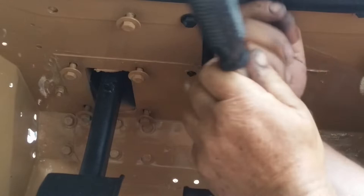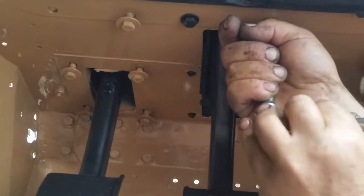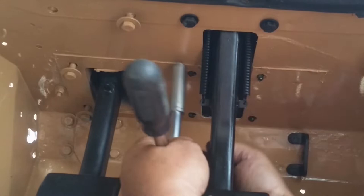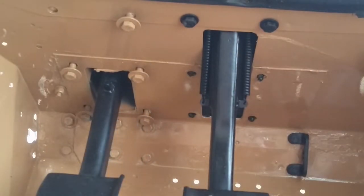Triumphs, Vauxhalls, Minis — everything from that era was a bolt with two flat washers, a spring washer and a nut, and it could be fine thread or it could be coarse thread. There seems to be no reasoning as to their choice of threads. It's just whatever their hand picked up as they reached behind them in the parts box.